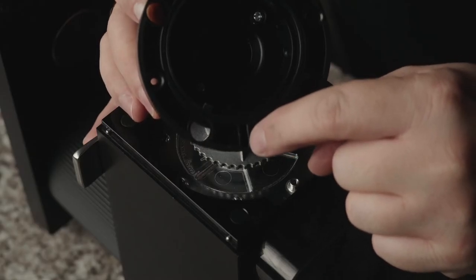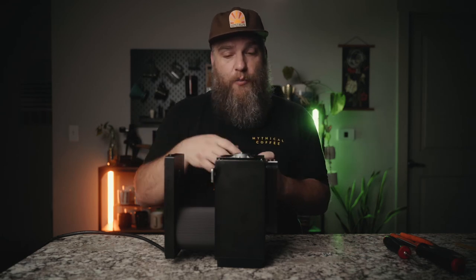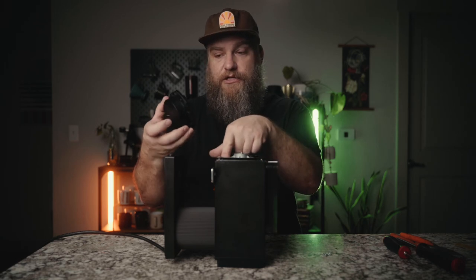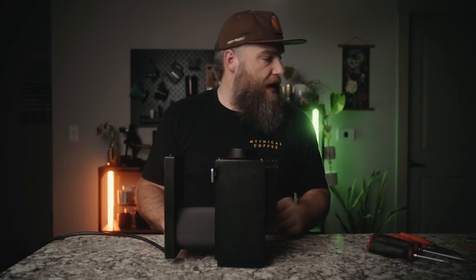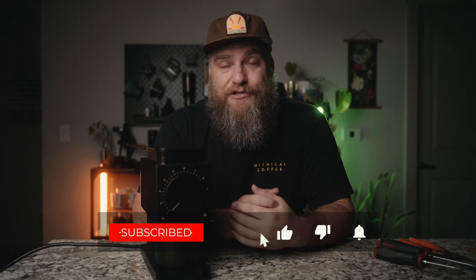On the back of the dial plate, the small piece lines up with that raised notch mentioned earlier. Set the dial plate to setting one — the finest, which is one click off of chirp — then reinstall it so it sits flat. If it sits crooked, the adjustment plate may not be lined up correctly, so the raised section meant to interlock with the recess is in the wrong spot. Make sure the dial plate sits down flush, then reinstall the screws. Once the adjustment dial screws are tight, snap the faceplate back on, flip your Ode over, and you're good to go. Your Ode brew grinder is back together with your new burrs — hopefully you learned something. Please subscribe, like, and share the videos. Take care, enjoy great coffee, and we'll see you on the next video.